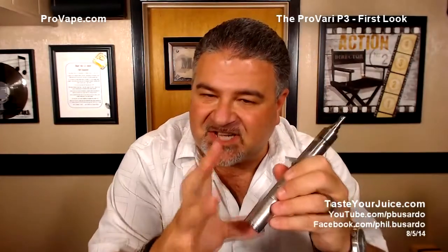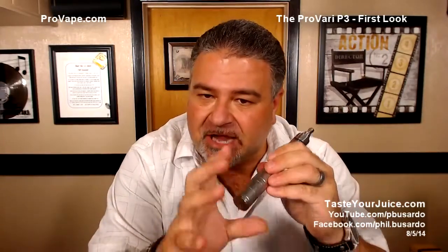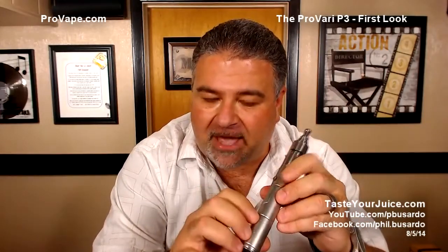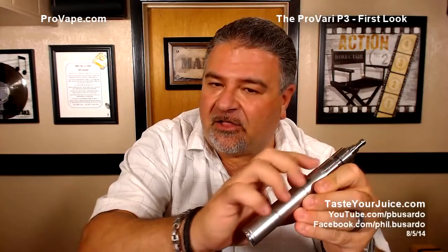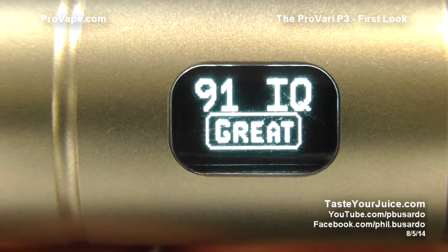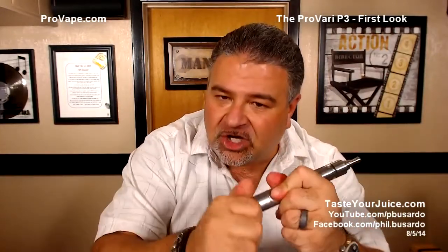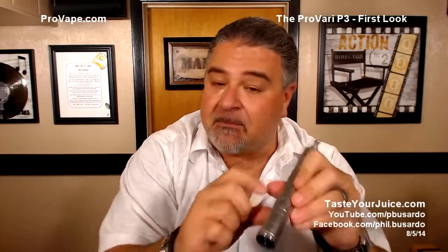Another feature of the device is this concept of an IQ. In this case, it doesn't stand for intelligence quotient. It actually stands for input quality. What's going on here is it's not only monitoring the battery and the health of the battery, but it also attempts to monitor all of the connection points and basically the health of the entire device from the bottom cap all the way up to the atomizer. So if you see the device has a low IQ, it doesn't mean it's not very smart, and it doesn't mean you're not very smart, but it means you could potentially have an issue somewhere. Check your connections, clean your threading, clean your contacts, clean your spring, and maybe replace your battery. So that's kind of a unique feature here too.